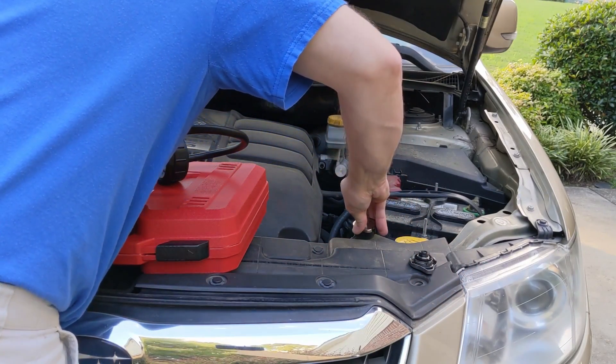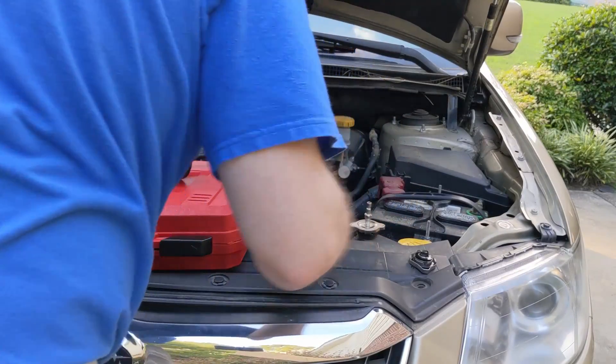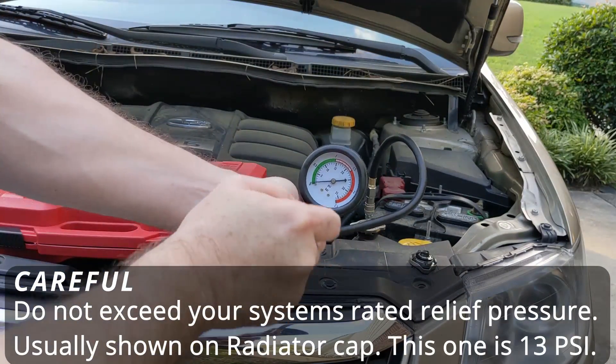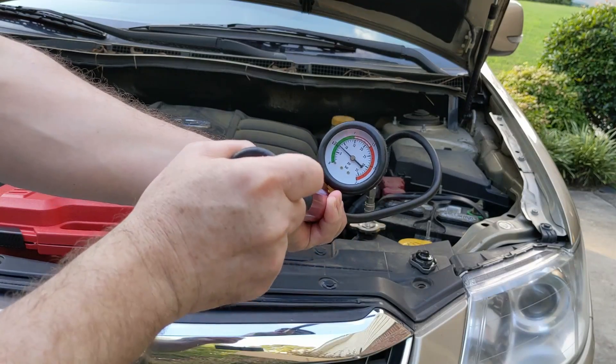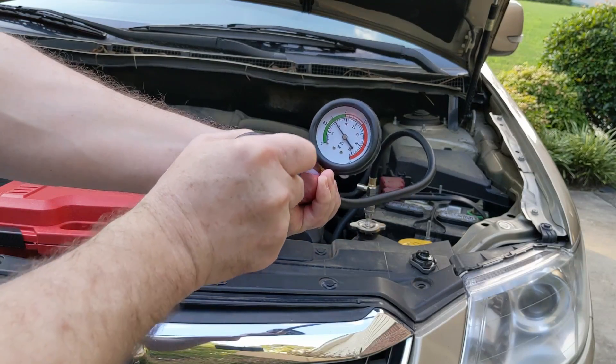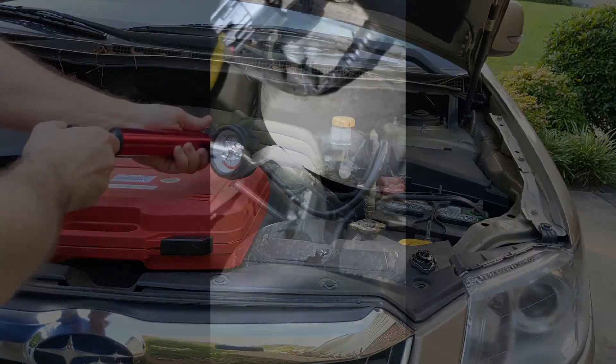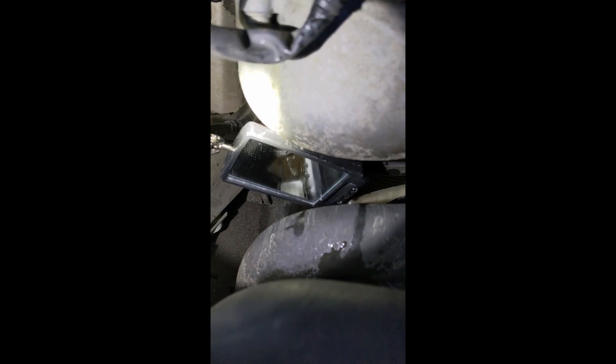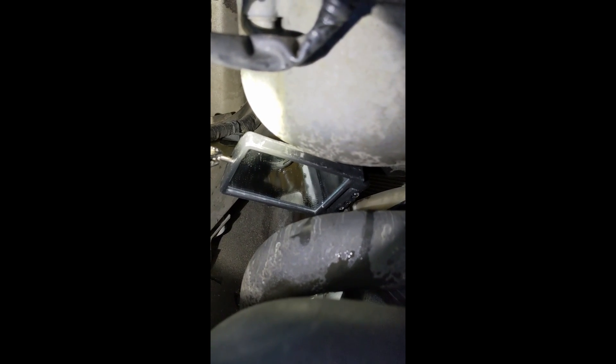The kit comes with caps and a pump. I chose the right cap for our Subaru. I pumped it up to 5 PSI and could already see the leak, then went up to 10 PSI to show it better on camera. You can see it bubbling out pretty good, and the pressure fell to nearly zero — it's still bubbling. Just as suspected, the leak is coming from the radiator seam on the passenger side, between the upper radiator hoses.